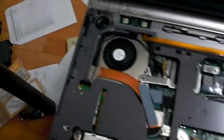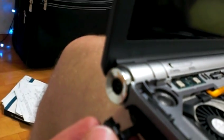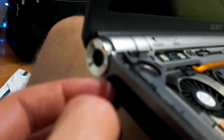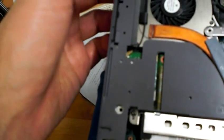Keyboard — there are two special secret connections they don't want you to see to detach. You have to slide this from underneath; there's a little slider. You open it from underneath and slide it forward. It locks and unlocks — you can see it toggling locked and unlocked.